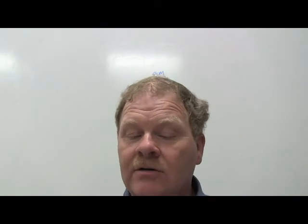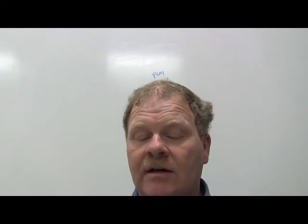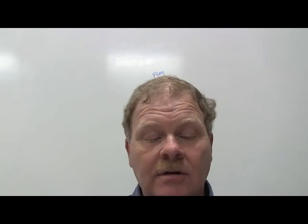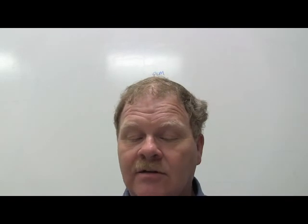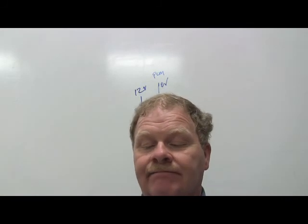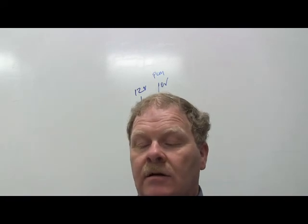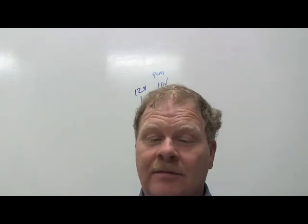When the concentration of oxygen on the exhaust side of the thimble is low, a voltage is generated between the electrodes. A voltage of what is generated between the electrodes? That's actually going to be B. Slap yourself. Okay, 0.6 of 1 volt. A large amount of oxygen in the exhaust system causes the oxygen sensor to produce which of these? A, a low reading. Low voltage. Slap yourself.